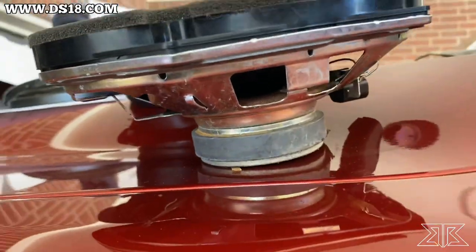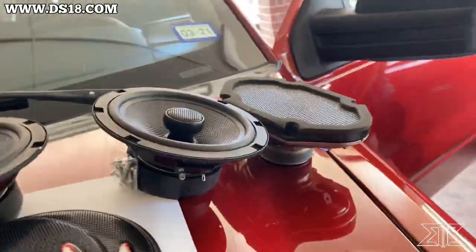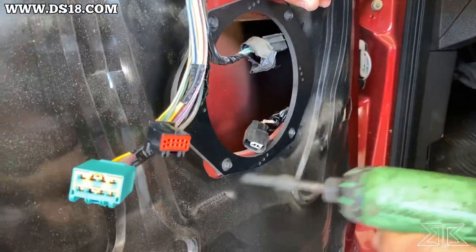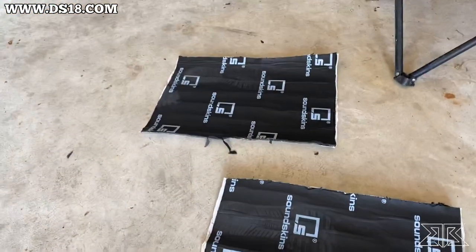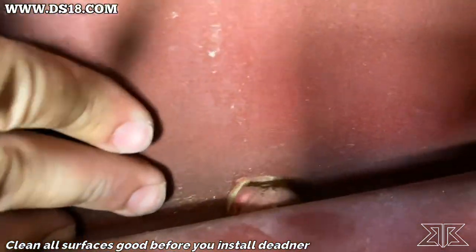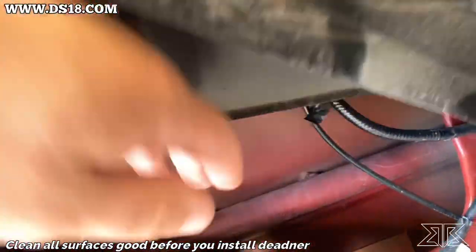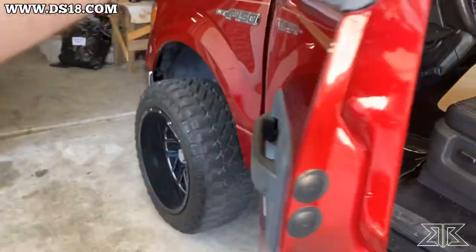This factory Ford speaker will be replaced. Like I said, we have the adapters. If you guys haven't seen how adapters work, it's pretty straightforward. We're going to make these fit the six and a half. With these Fords, they have a little bit thinner door, so this one's flexed and things are messed up. There's going to be some rattling on this door skin regardless, but if we put some of these SoundSkins, these aluminum shells won't flex as bad.